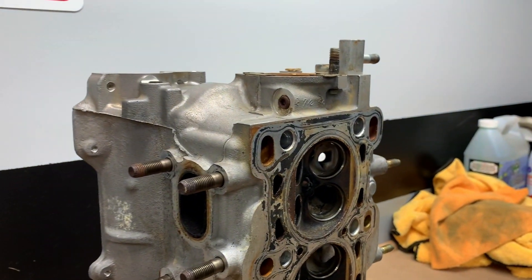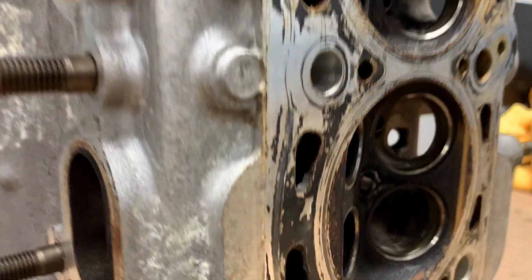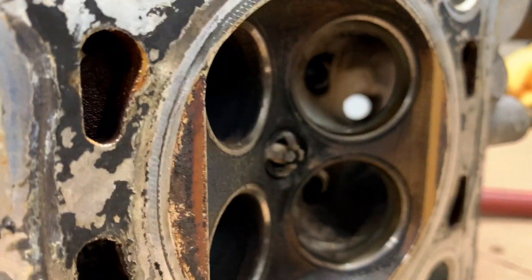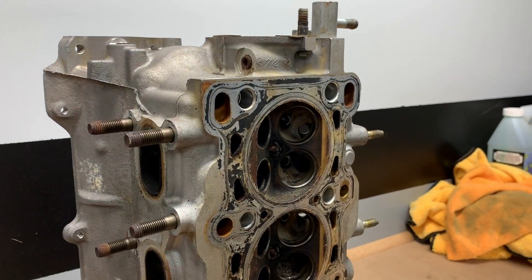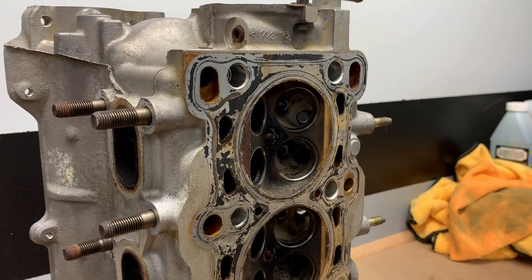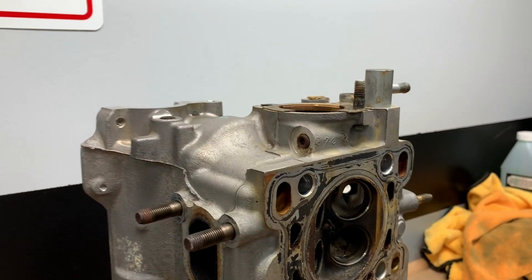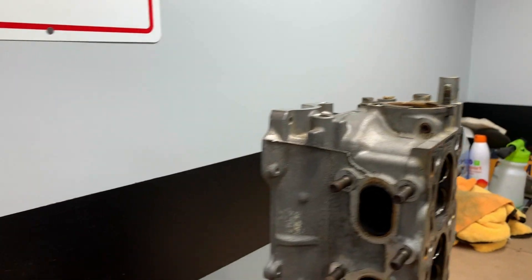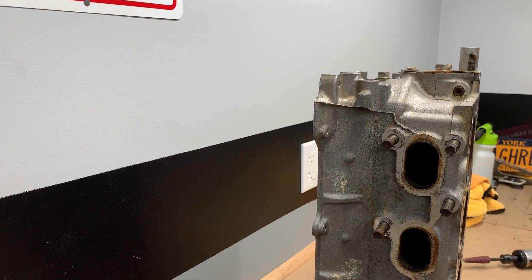I just want to make it flow a little better if we can. Results may vary, so we're going to play carefully here. These VVT heads already flow way better than an NA8 or an NA6 head, so we've already made a big step in flow that way — this head should be way more powerful than a factory NA motor, so good call on switching that over.